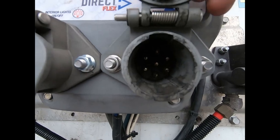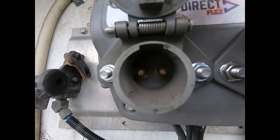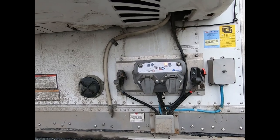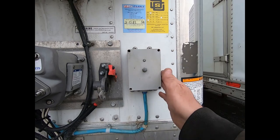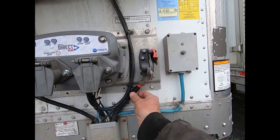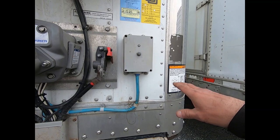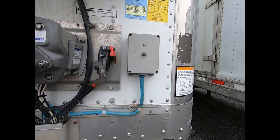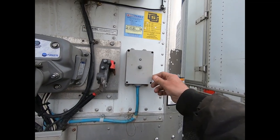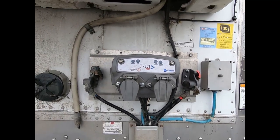We have the normal seven-way connection that we have on a trailer without a liftgate — checking those pins, making sure they're not broken, making sure they have dielectric grease. Same thing with the dual pole connections, making sure we don't see any corrosion. Most of the charging on this unit is done by the reefer. There's also this box here used for the interior lights — sometimes you'll see it plumbed from the airline supply side from the emergency glad hand, which cuts power to the interior lights when the brakes are released so the lights aren't on while driving down the road. This one just has electric going to it and uses an accelerometer — if it senses forward or backward movement, it kills power to the interior lights.